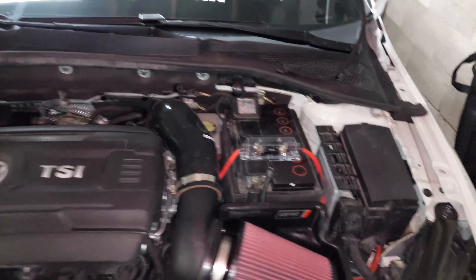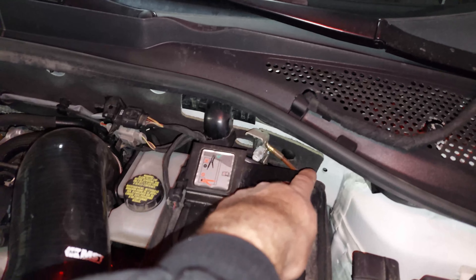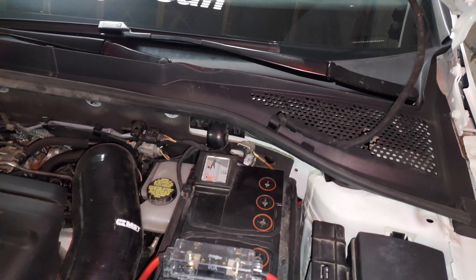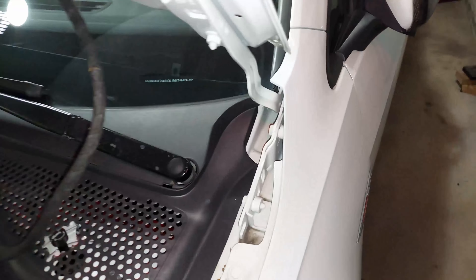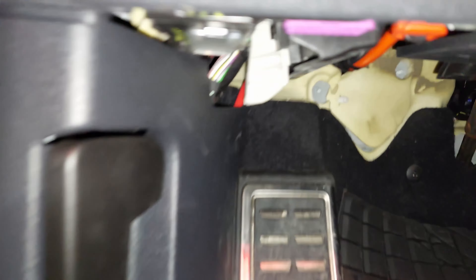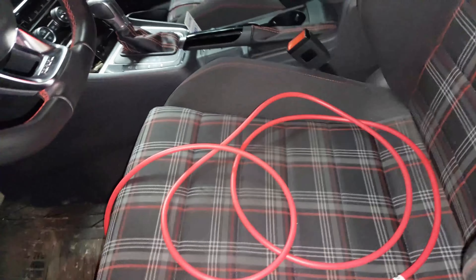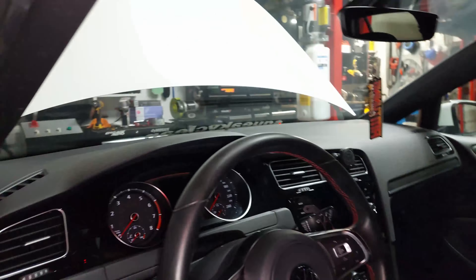For wiring, we're going to run a main wiring harness from the battery. Right behind the battery there's a grommet that goes through the firewall — very easy. You can access it close to the clutch if you have a stick. I have a DSG automatic, so it comes out around here. I'm going to run it behind here all the way to the back. That gives me a main supply wire for the management, and I'll also feed the controller wire from the main harness so the control wire is nearby.